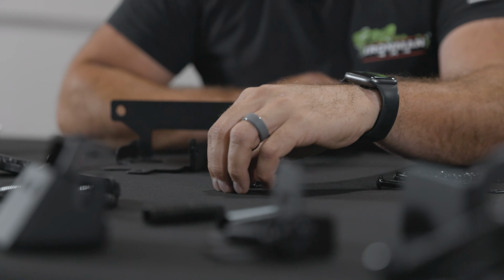All right, last thing we need to do, see that little octagonal cutout right here? This little hole right there needs to be opened up to fit an M10, like that. So grab a step bit or a drill bit, and we're gonna open this up. It's nice soft aluminum, so you don't need to go crazy. Perfecto. All right, check it out.